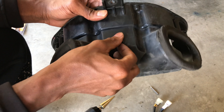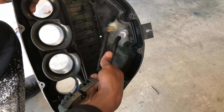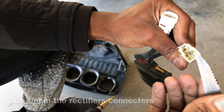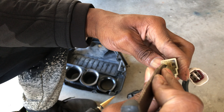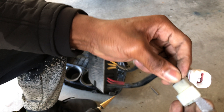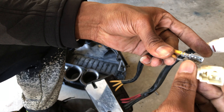Here's our hole — obviously the connectors aren't going to fit through as-is, so I'm gonna take these rubber pieces off. To take these out, I'm using this knife since it's got a really pointed edge. You've got to push a pin in and kind of pull down on the wire. I believe I've got all three of them, and it just pops right off. I'm gonna do the same thing for the next connector.